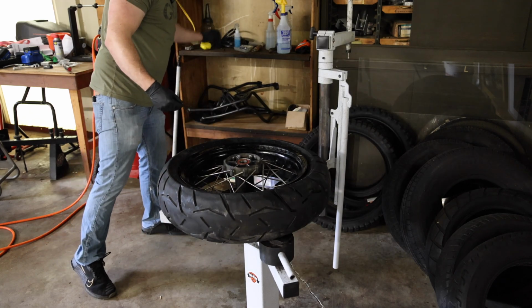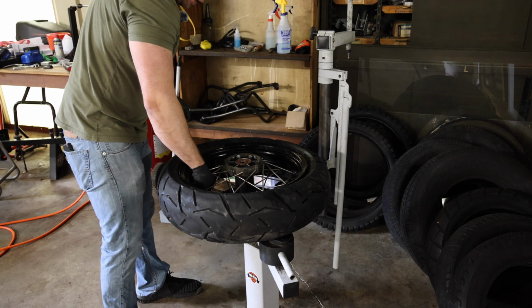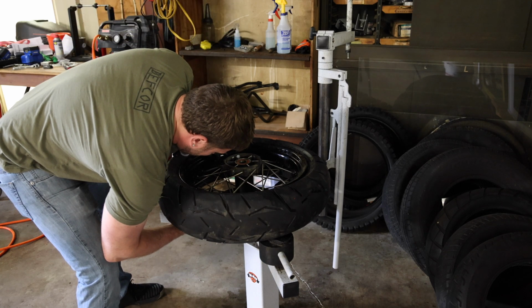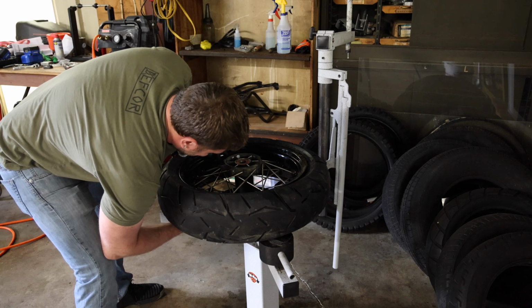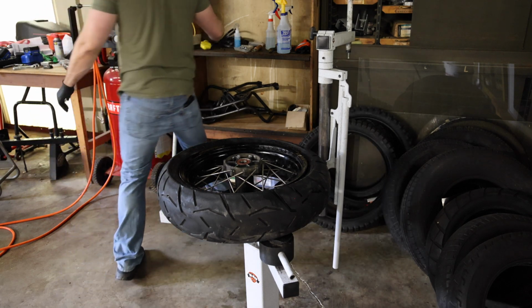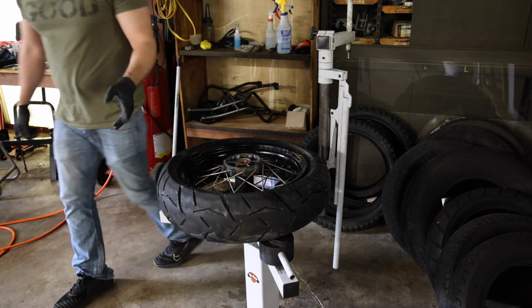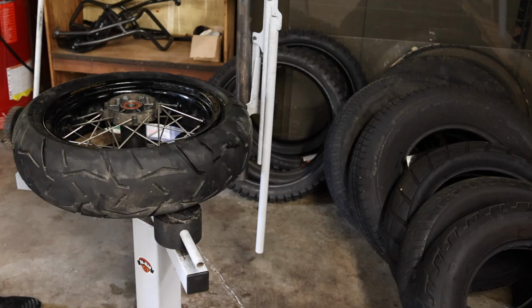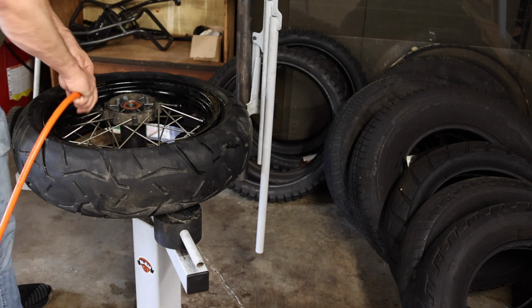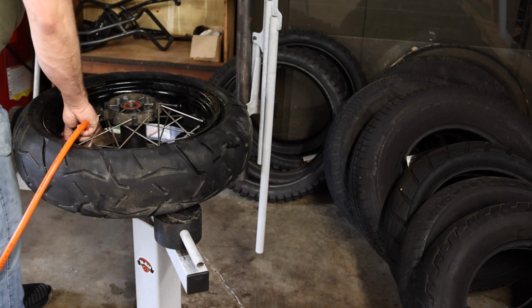All right, next up, we're going to take our new valve core and use our valve core tool. I'll link that down in the description if you want one of these Motion Pro ones. They're pretty nice, especially on spoke rims. I'm going to go ahead and seat that down. Now I got to fire up my air compressor and get some air in this thing, make sure it holds. All right, so with the tire off the posi clamps, just sit back on these other ones. We're just going to attach the air hose and it should pop back up on the bead.